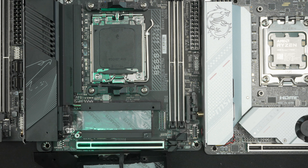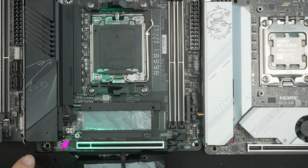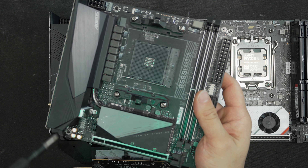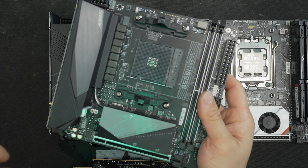While troubleshooting this board I needed to reset the CMOS, but unfortunately that clear CMOS header is in a very inconvenient location if your build is complete — it's underneath the add-on M.2 riser card. At a minimum, you'd need to pull your graphics card out and access it from the bottom. If you're doing RAM overclocking, you'll need to do that testing without your GPU installed or pull the card each time. You might consider connecting a reset switch to that header temporarily while doing RAM OC. By comparison, the B550i's CMOS header is more accessible, and the MSI B650i has a button right at the back — so why can't they just do that?